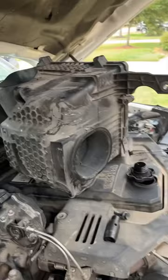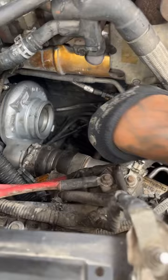I'm on the passenger side. I took out the air box right here, and the air ducting that goes to the turbo. Now coming up, you have full access and range right here. I can literally take the filter, screw it off carefully once it's loose, drop it down, and bring it straight up and out. Quick tip for today.